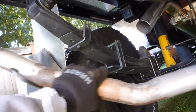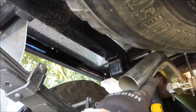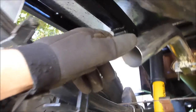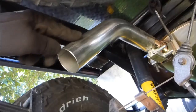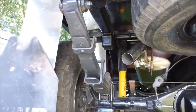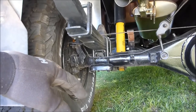Another thing I did is take off the original tailpipe, which routed the exhaust from the muffler out between the tire and the mud flap plate. I got a 45-degree mandrel bend, downturn, and I'm shooting it out between the leaf spring and the spare tire in the back. It seems to work so far — I only have a few miles on it but it blows most of the heat out here.